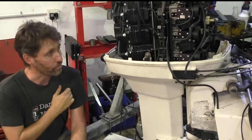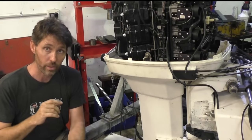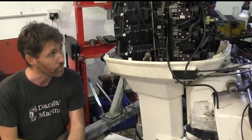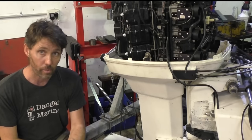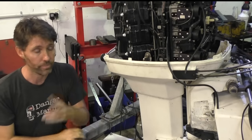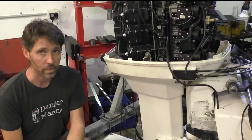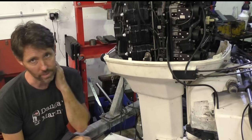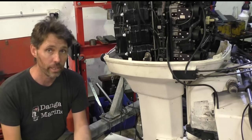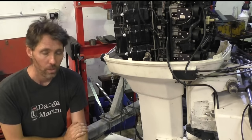The second thing is just making sure that any potential cause of the original problem is gone. A viewer commented during the week that when they rebuilt one of these, they actually went up one jet size just to make it run a little bit richer, because they felt that running lean was the problem — it wasn't that the carbs were dirty, they just felt it needed to go up one jet size. At the time I thought, well, clearly the factory's chosen the correct jet size. But having read that comment — and I'm sorry I can't remember your name, I see a lot of comments — the carburetors are clean but they're the original jets, as they came from the factory, so I'm relatively comfortable with that.